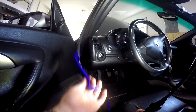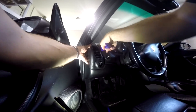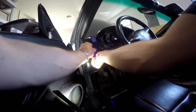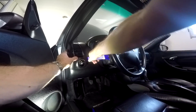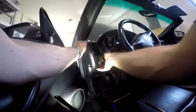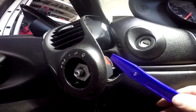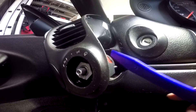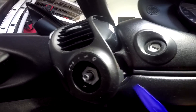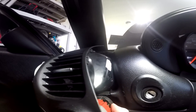After you've got all three of those screws out, get your plastic trim removal kit and pull this panel off. Now you have to pull this off — use a plastic tool to get in between the big black piece and the red piece. The black piece is just pushed onto the pins on the red piece, so pry it off with a plastic tool. Once it's started you can grab it with your hand and pull it the rest of the way off.